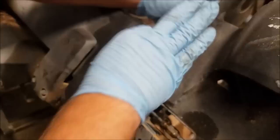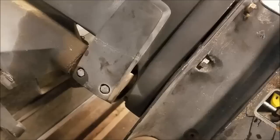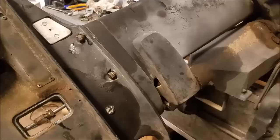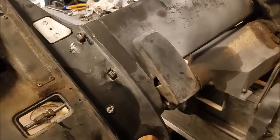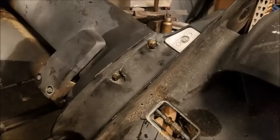They're starting enough now. As I removed the extension housing from this, you're going to have two bolts — a shorter version and a longer version. The shorter versions go from the gear case; the longer versions are for the extension housing. Every bolt needs to get coated in the gasket sealing compound so it doesn't ever seize up on you. Push the lower into position and thread in the screws. The lower is about ready to go — you don't want to use the screws to force it in; it needs to go up naturally. I give it a little push and I can see everything is going to seat perfectly fine, so I know I'll have no issues tightening these screws down.